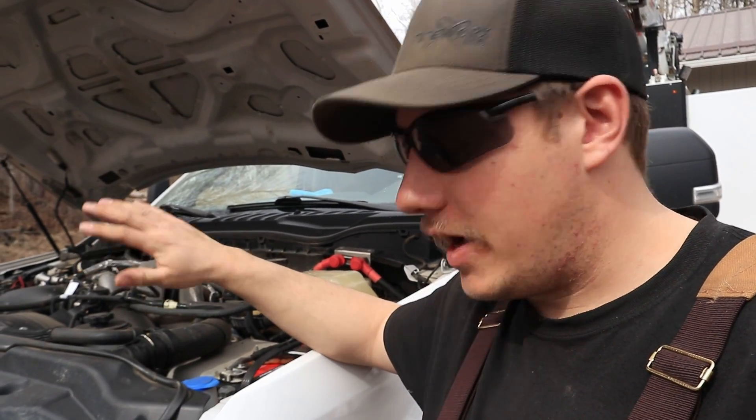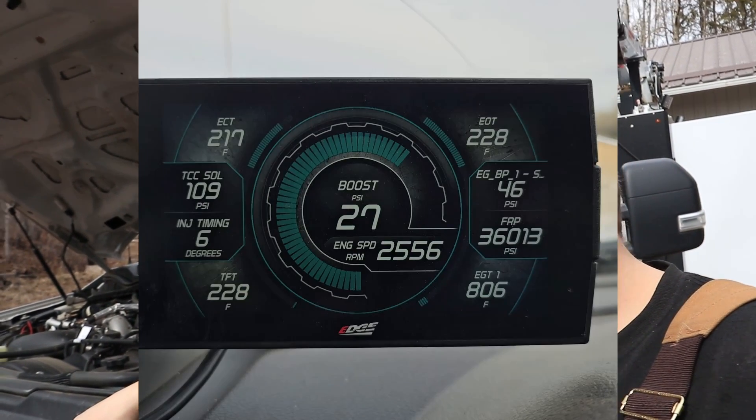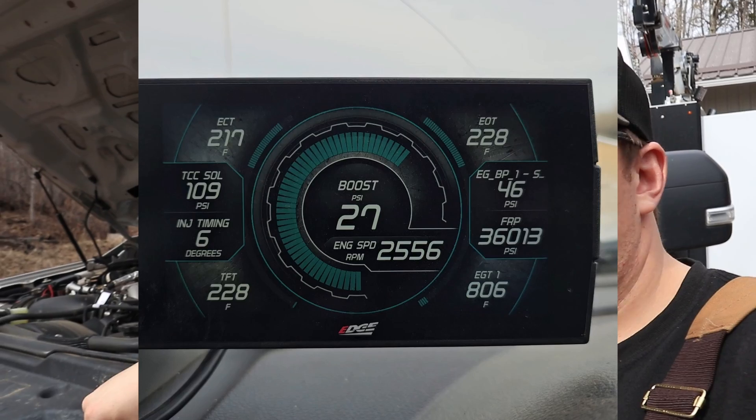With this thing weighing the way it does and with the gears, it's got 225/70 19.5 factory wheels. Running down the highway at 110 to 115 kilometers an hour, it's about 2,300 RPM in top gear — between 200 and 220 degrees Fahrenheit coolant temp. But the biggest issue is the primary cooling system is also what cools the transmission on these. This turd will sit all the way up to 230 degrees Fahrenheit normal coolant temp, and right around 230 oil temp all the time — completely stock.